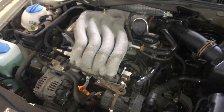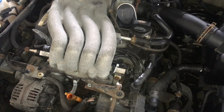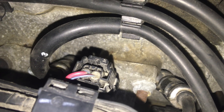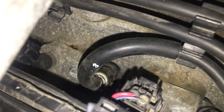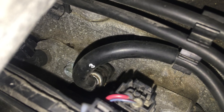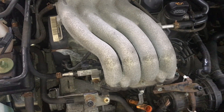That's a little video on your spark plug locations and types on your Jetta GLS 2.0. The last thing to remember is there's a special spark plug wire removal tool for Volkswagen engines. I didn't use it — I used a pair of vise grips and it worked fine — but the proper tool would make it a hell of a lot easier. Also use a swivel attachment for your ratchet, because there's no way you're getting to that fourth plug without taking off the manifold, and in my opinion that's way too much work for changing spark plugs.